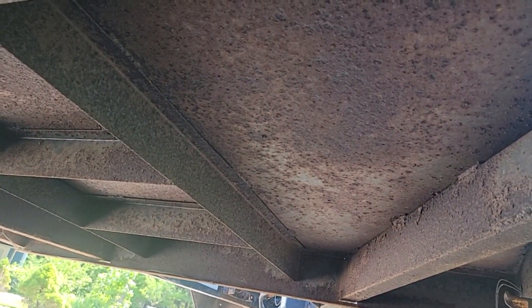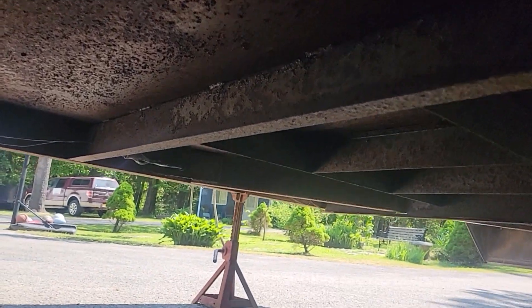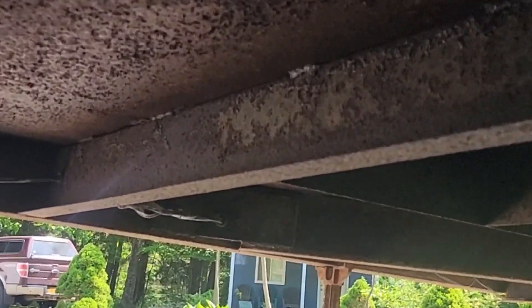Everything looks pretty good in the back. Up in the front, the tongue comes through the frame rail and fastens back here — that looks pretty good. The frame up front looks pretty good. The wiring harness goes down both sides, through the frame through a grommet to the brakes. I think I can leave that alone. This rust we're looking at is all flaky surface rust. It would be nice to sandblast it, but it's not worth it. Maybe rust reformer or fluid film — I've got some of that left. The best way would be to flip the trailer upside down.